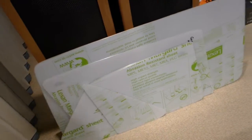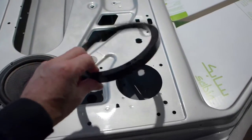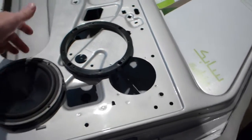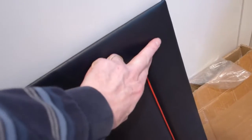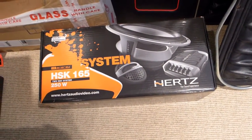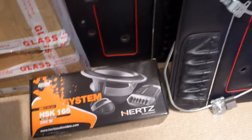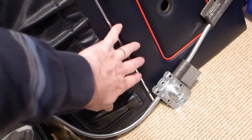As I assemble the doors I can use all the stuff. I've got my spacers for the speakers, and basically I'll be trimming these down a little so the speaker can fit in from the back. Instead of cutting a hole and putting a surface-mount tweeter on the door card, I'm thinking of putting the tweeter in the dash speaker area. The Hertz tweeter looks a bit ugly, so I'm thinking of hiding it in the dash and putting the woofer holes in behind this area here. I'm trying to make it look really pretty.